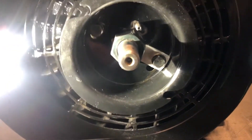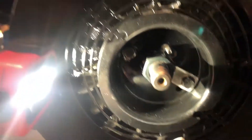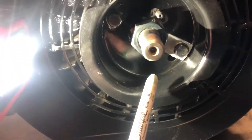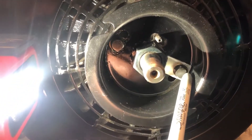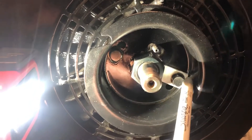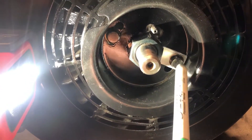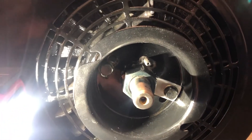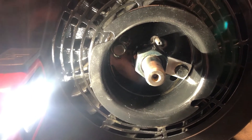Well tubers, what I've come up with — I don't even know if it's going to work. One of the bolts that bolts on the pull start pulley — I've cut a piece of aluminium and lined it up with the nut and that radius. Hopefully if the nut tries to turn, that'll all lock up. Hopefully it'll work. Well, we'll find out — we're about to give her another run.